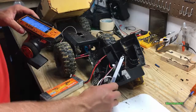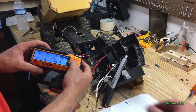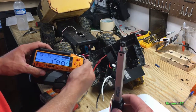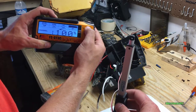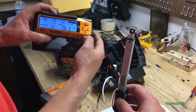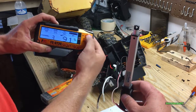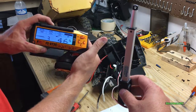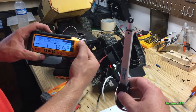Hey Brad, bring your transmitter over here so we can see what you did on the camera. You're going to get to play with it a little bit to get a feel for it, but here's what we learned. When you first get your transmitter it's going to be sitting on model. You scroll to the right or the left — left works quicker — and you hit endpoint. It says E point in the top right and endpoint adjuster below. You hit enter, then scroll over to channel three, which is the channel you want, and then hit end to get to where you can adjust. It took us a while to figure that part out, but once you do, you just scroll your toggle and as you can see, changing where the endpoint's at is what makes the actuator move. That way, when we bring the bed all the way back down, we can set where we want the actuator to stop so it doesn't keep trying to pull the bed down into the frame of the truck.